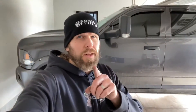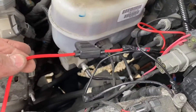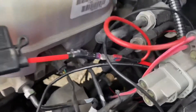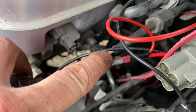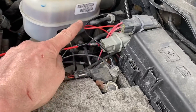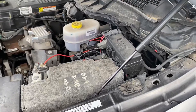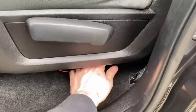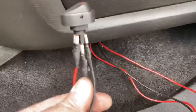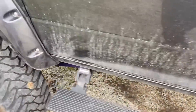Just to clarify the wiring: for the positive, I tapped off a lead wire that already has a fuse — the one I was using for my steps — using a shrink solder coupling that solders and shrinks at the same time. That positive wire runs to the positive of the switch. The negative lead from the battery goes to the negative of the switch under my seat. A positive wire from the switch goes down underneath the cab into the control module, and the negative coming off the control module is grounded to the frame of the truck.